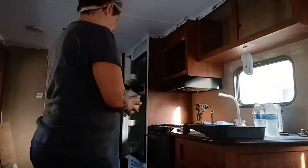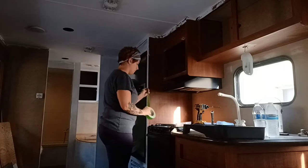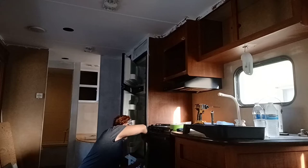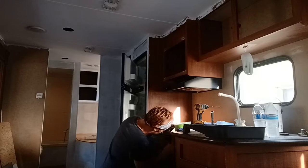I'm not too worried about the slide out portion yet — that's going to be its own total can of worms. Here you can see there are a couple of tight spaces around the oven and the vent hood that are going to need paint, and I'm going to tape off around those joints of the appliances. Normally I don't use a lot of tape in my other painting projects — I prefer to cut in by hand — but painting a camper, trailer, or RV is not the same as my other painting projects.